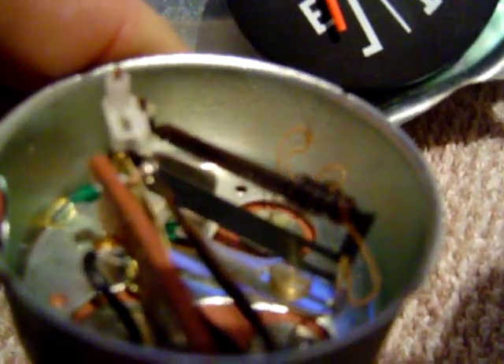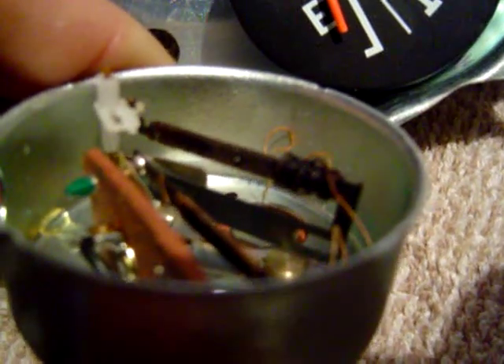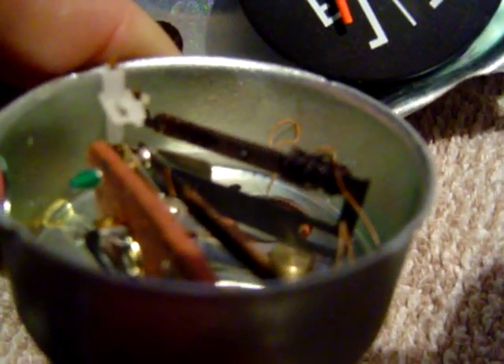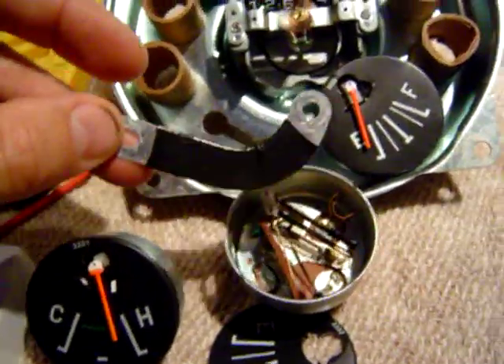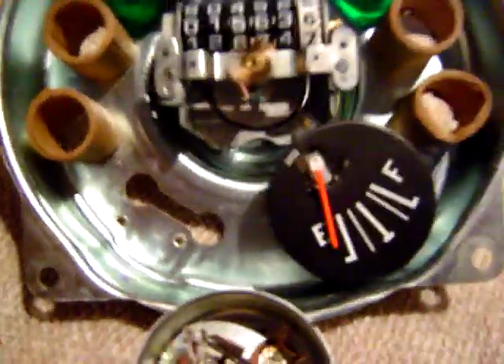It's hard to see, I'll zoom in and turn it a bit. As you can see, this thing's fried. What occurred here is that the whole speedometer casing was hot — the red wire that comes in around the back charged the whole thing. This is the ground bar which goes between the two on the back side, and it was never really grounded, so a complete circuit was made.